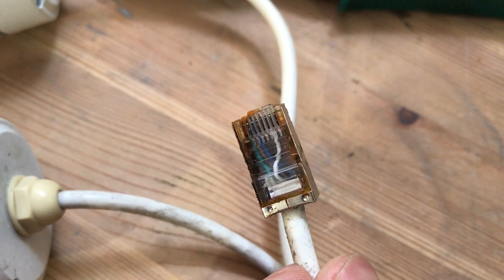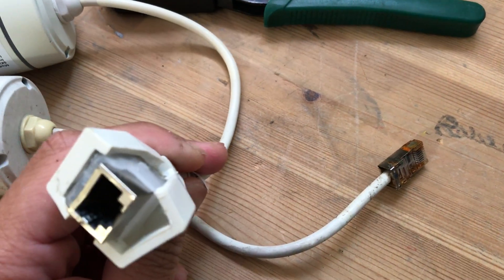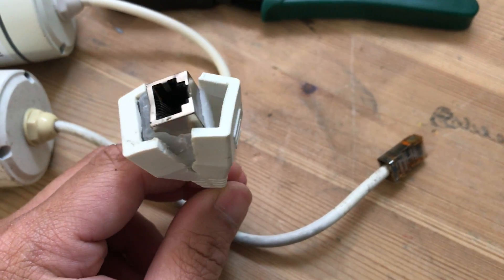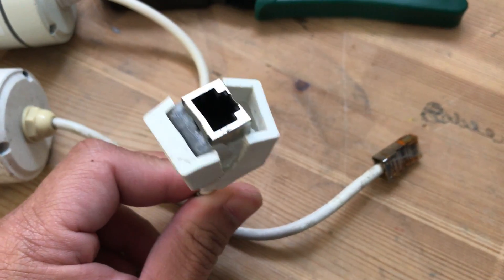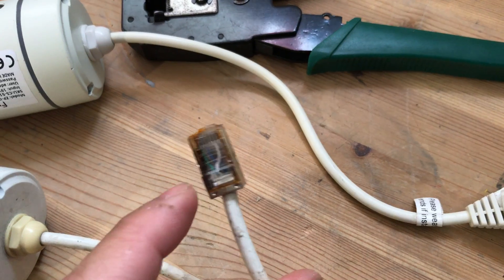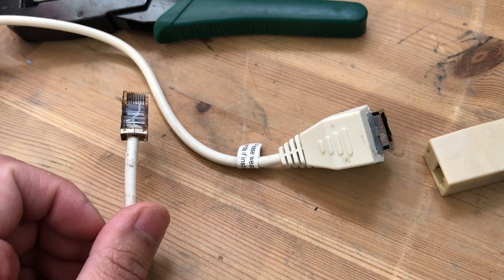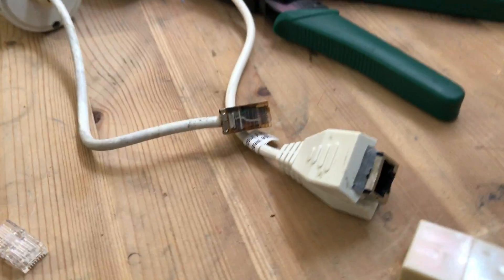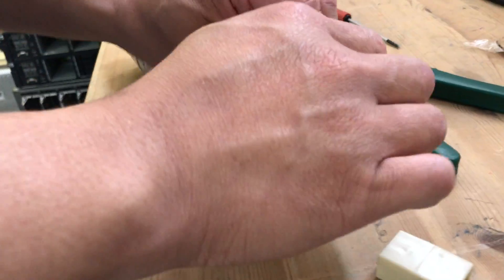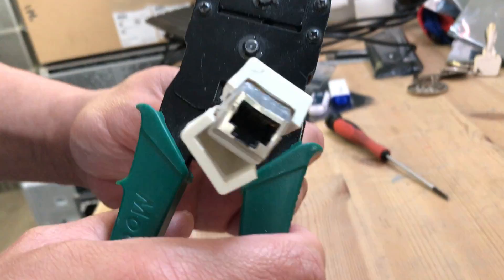Based on the website, if you are under warranty you can send this back for a warranty replacement. If you are out of warranty, you need to redo the camera cable. The first two cables are green and brown, the third is blue, and the sixth is white. To fix it, you need a network cable crimping tool — cut the old connector off.